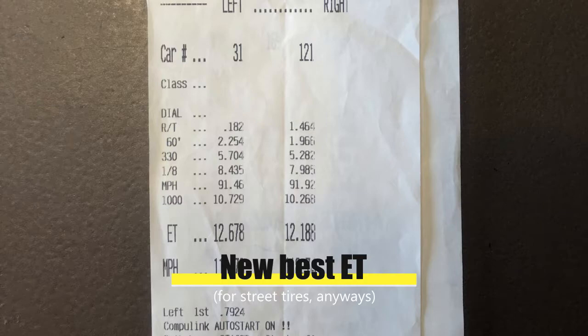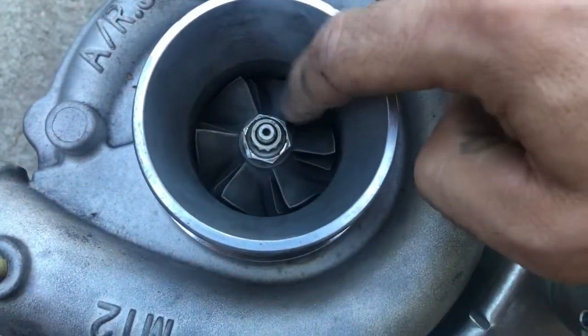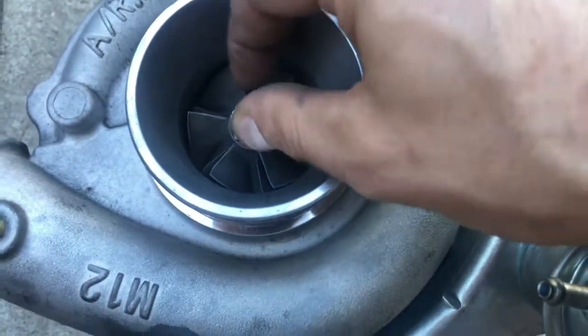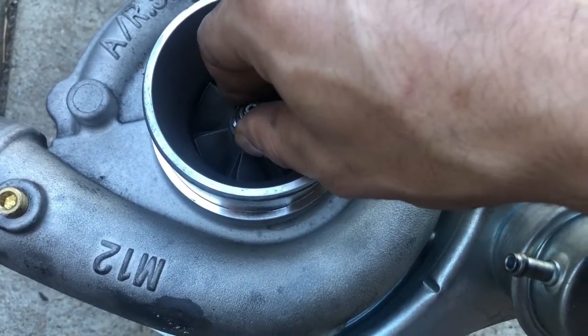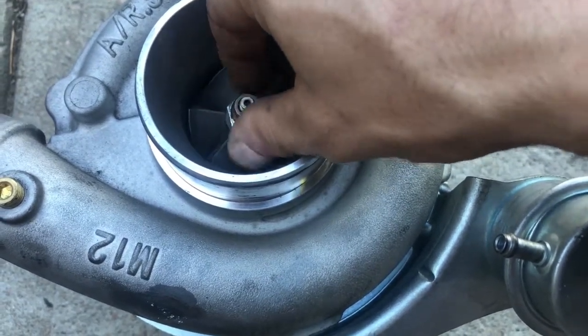I'm driving back from the track and I almost made it, but I've got a serious rattling sound and something's broken. See if you can hear it. The problem is, this thing spins awesome, but it doesn't look right. There are bends at the tips of the blades — that's not supposed to be there — and there's a big gap between the housing and the wheel. It's because the bearing cartridge failed. It had a little in-and-out play, like the other one, but since it wasn't smoking I just let it go, and this is what happens when you do that. It completely eats itself alive.